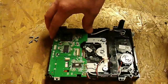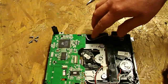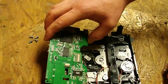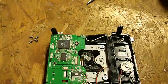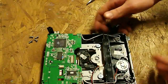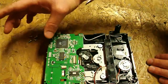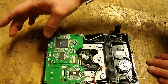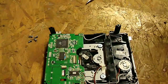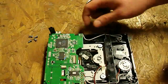This is your old drive. The first thing you want to do with your old drive is go ahead and desolder everything — melt everything and take all these wires completely out. Then you'll just be left with your old PCB board. We're going to pretend this is now the new drive that you just bought, and you're going to be holding the old PCB board — the one that's going into the new drive. As you can see, there are a lot of wires: a bunch of white ones and a bunch of red and black ones side by side, so you don't want to get those mixed up.